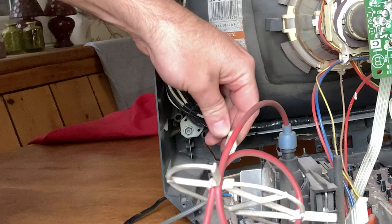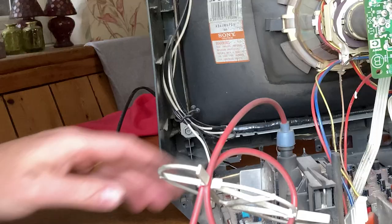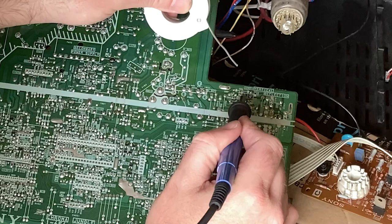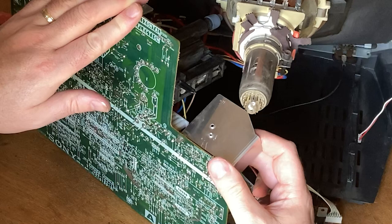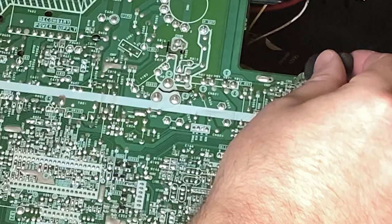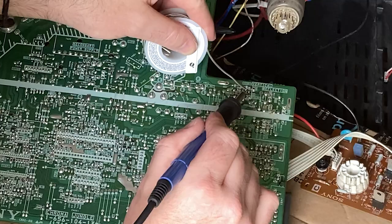Trace the plug straight to the main unit — is the fuse blown, is the cable worn or damaged? Then work your way through; don't jump to assuming it's the cathode or anode. Next, use a multimeter on continuity mode to check that current is getting from one end to the next, then check voltage, resistors, and capacitors to make sure you're not losing signal across the PCB. I didn't find any lost traces apart from the area around the vertical sync IC. I then applied flux — this helps the wetting of the board pads so the solder joint doesn't oxygenize and crack.